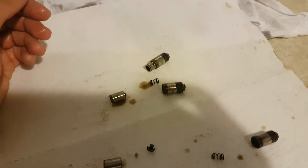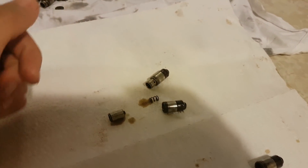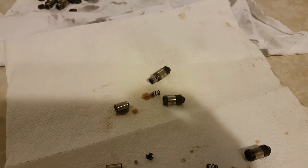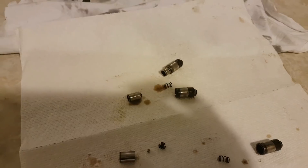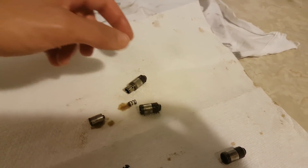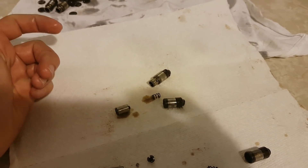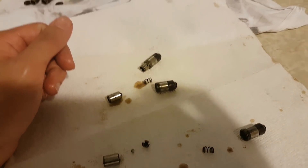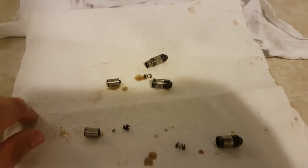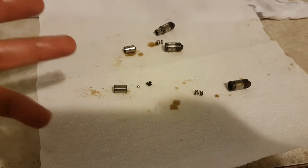As opposed to a solid lifter — which you may have heard of — where you need to adjust the lifters manually and there's no self-adjusting mechanism. The problem with solid lifters is you have to adjust them from time to time, and they're also noisy because on cold starts there will be some gap until things expand and fill it in. That's why a solid lifter never really works as well as a hydraulic lifter. The benefit of solid lifters though is that they're lighter, which decreases the chances of valve float.